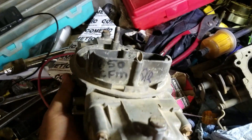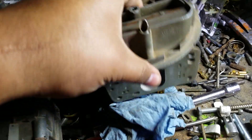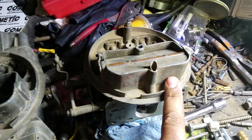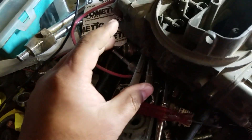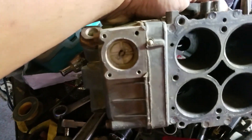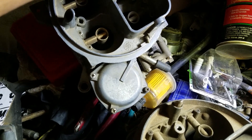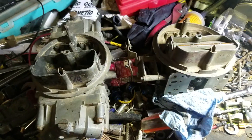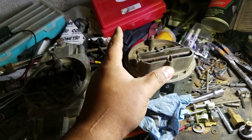What I've got here — they're actually upside down — but this one is a 650 double pumper Holley carburetor, and this one is a 600 double pumper Holley carburetor: list number 4776 for the 600 and 4777 for the 650. What makes this a double pumper and not a vacuum secondary is that it doesn't have the vacuum secondary pod and it also has a provision for an accelerator pump on the secondary metering block — which is why it's mainly called a double pumper. If you've got a vacuum secondary 600, 650, 750, etc., it'll have that vacuum secondary pod.